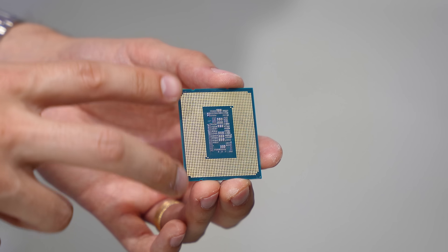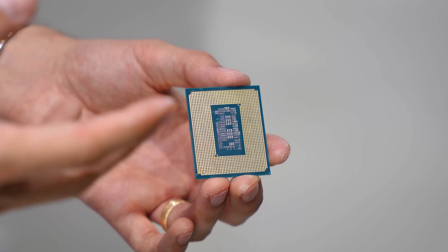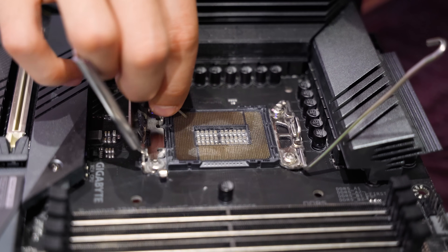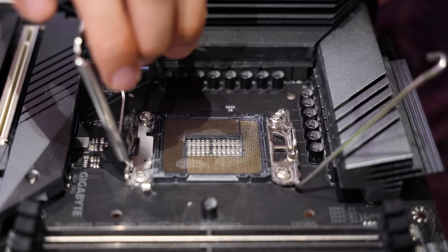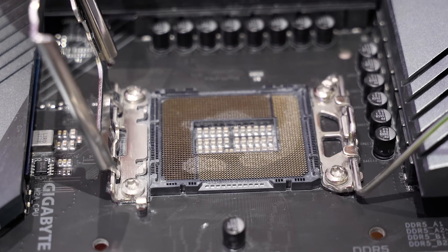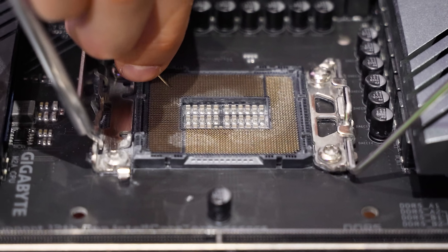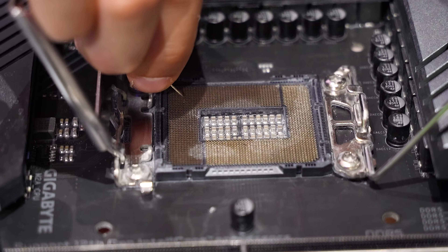If you're not privy to using an electric duster, you could use a can of air or just allow the chip to sit out for a few hours so that all the isopropyl alcohol evaporates before reinstalling into your motherboard. I've been carefully adjusting some of these pins — it turns out there were several just slightly bent pins that I couldn't see from my perspective. There were about 12 that needed to be adjusted, and I've gotten them as close as I can get to factory without risking any of these snapping. If one of these snaps, the board is basically a brick.